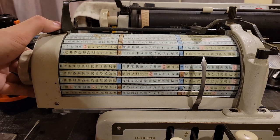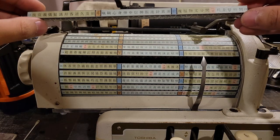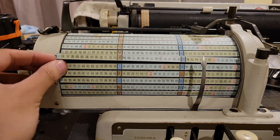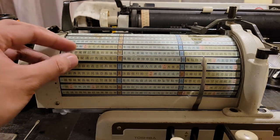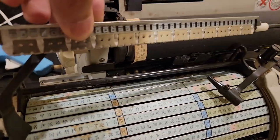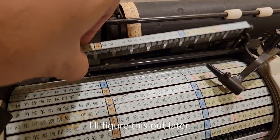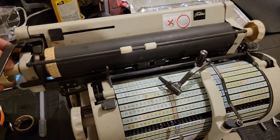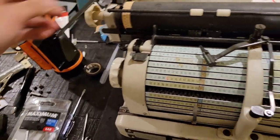Might as well stick it back in. I realize now that it's supposed to fit within this slot here or guide. I had originally thought that this guy here was the carriage release, but it turns out that it's rather this lever. Since that ratchet is still working, I'm pretty sure the escapement should still be alive — I just need to find out what's causing it to stick.